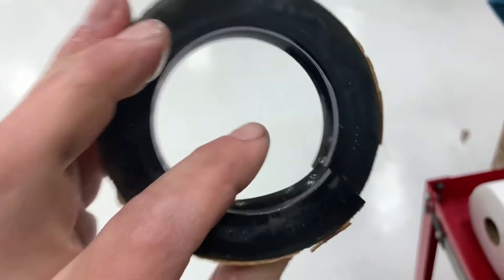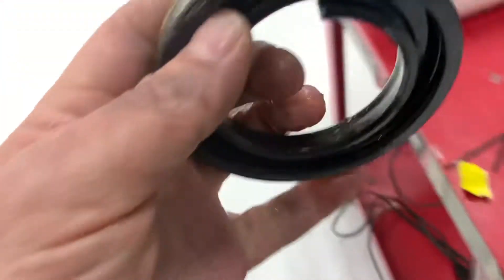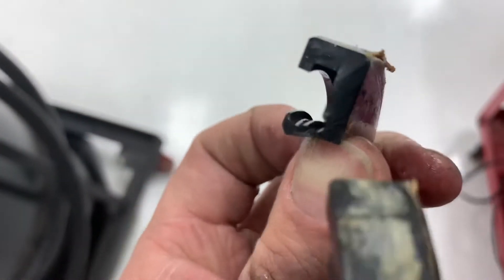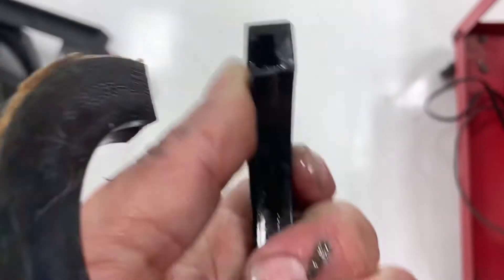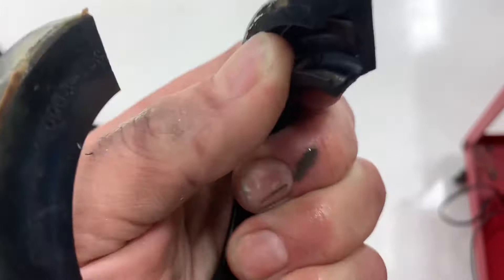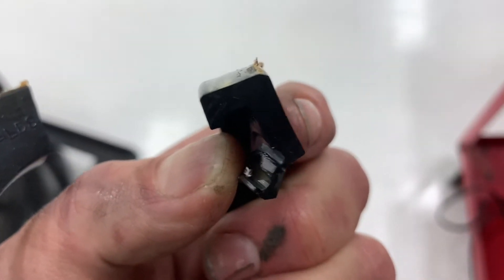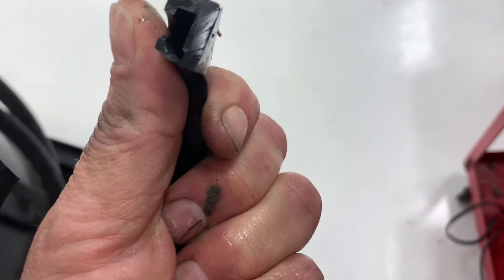Here's a shot of the old seal. Here's the doubler ring — you had to cut it to take it apart. You can see this area here has a lip that presses down on the crankshaft so it doesn't let the oil come past it. There's oil pressure on the thumb side that pushes this apart and pushes against the crankshaft. The spring holds it tight. The doubler ring keeps it from pushing up and collapsing.